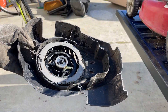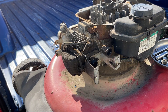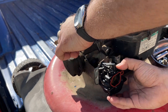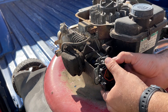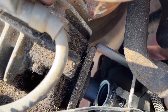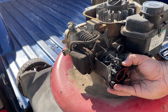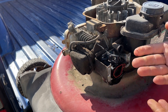I'm going to turn the air compressor on and blow all this stuff out and I'll be right back. So now we're going to put the carburetor back on. Slides on just like that. A lot easier with the recoil removed, by the way. If you look inside the carburetor, there's a white retainer there, and then there's an O-ring right in the middle. You want to make sure that those stay on the carburetor. Sometimes they'll stay on the intake throat — if they do, just pull them off and put them back into the carburetor.